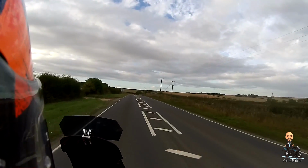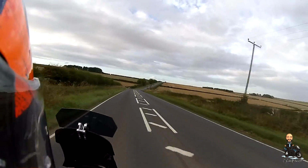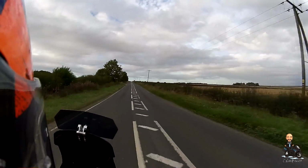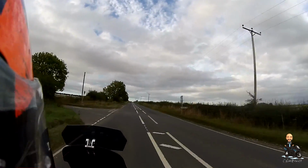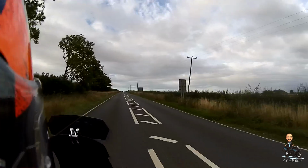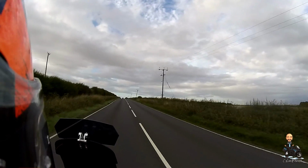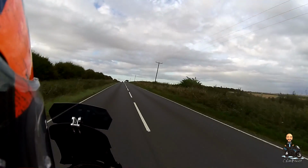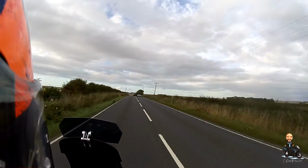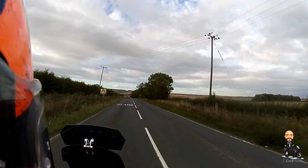It's a metal weight on a stick, and as you're riding, that weight vibrates up and down, which opens the chamber and lets oil out. And when the bike stops, it falls into place and shuts the chamber, so no oil can get out. So basically, it only works when you're riding, but without having to be electrical or vacuum or anything like that. I suppose it would probably be a problem if you were trailering the bike. You'd have to remember to turn the valve completely shut on the flow rate control.